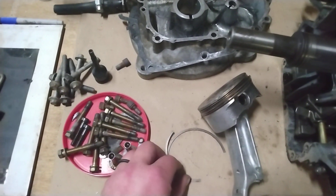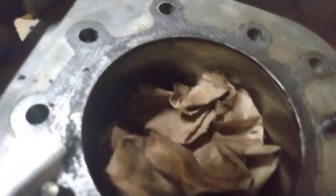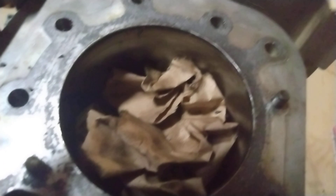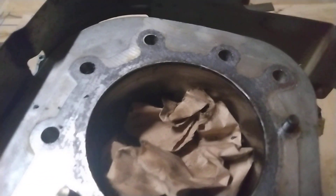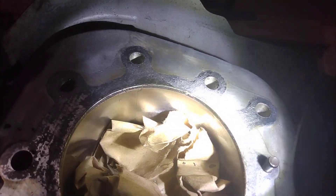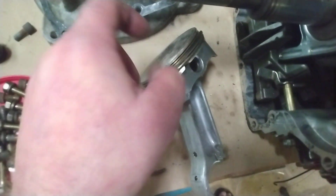It was actually broken. I racked my brain over where that piece of metal could have come from. I took the bowl off the carb and the float was just missing the pin. I'm not 100% sure that's what happened, but I can't think of anything else that could have gotten through my intake to do that much damage. Things just don't generally come through the exhaust, and being that the oil rings and bottom compression ring were good, I'm going to assume it came from the top.